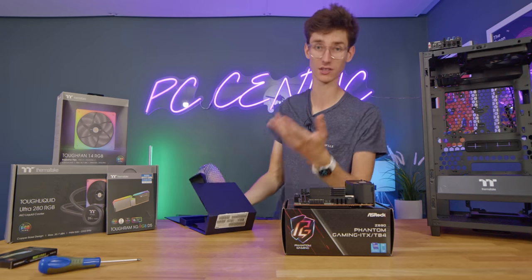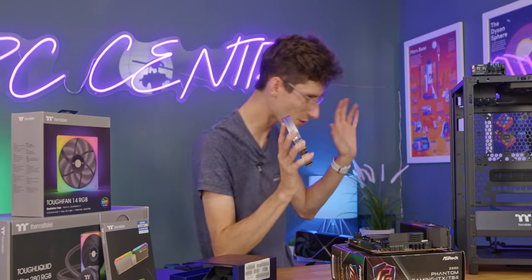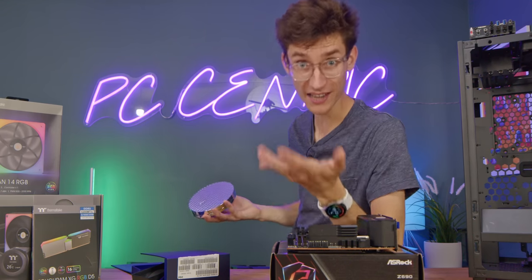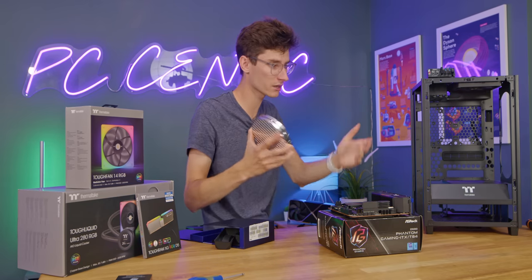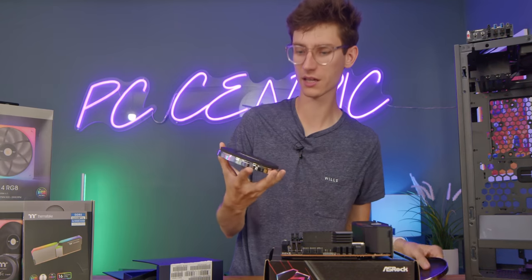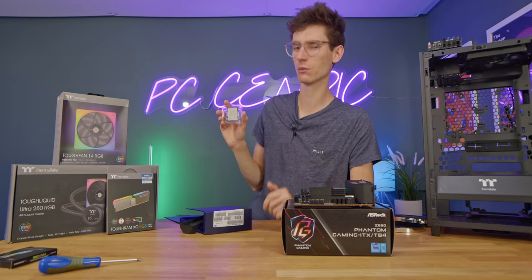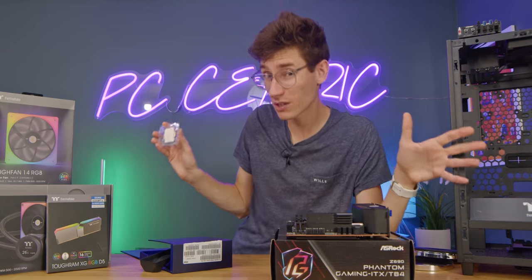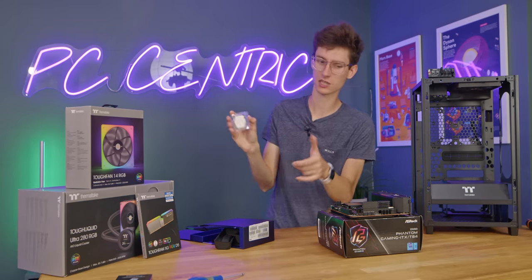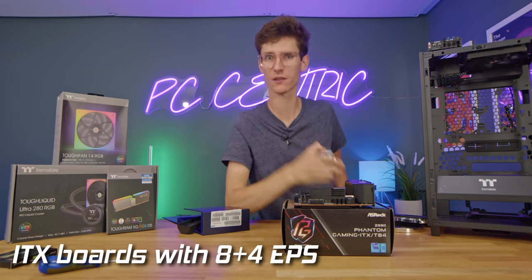If I'm honest, Intel hasn't asked for this back yet and I want to do something crazy. I'm thinking if I watercool it, especially with hardline, they might just let me keep it. The only problem with this approach, besides the fact that this is an ITX motherboard, is that this one only has an 8-pin power connection up at the top. I did look it up and I think you can get around about 380 watts out of an 8-pin, so performance is going to be absolutely fine. But this CPU can consume an awful lot, especially if you're going to want to overclock it. So buyers would probably want a motherboard that does have an 8-plus-4 configuration, but I couldn't really see any available.